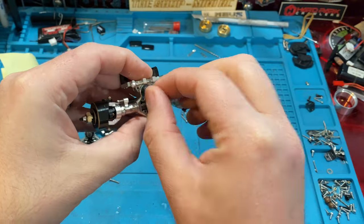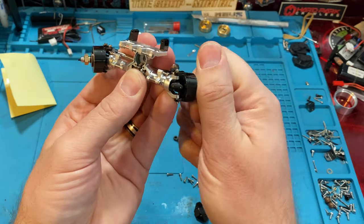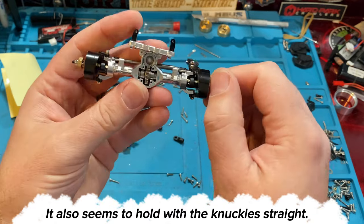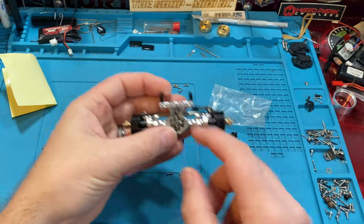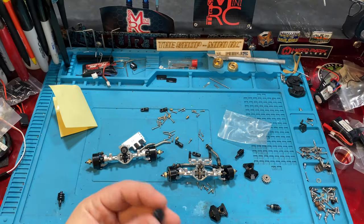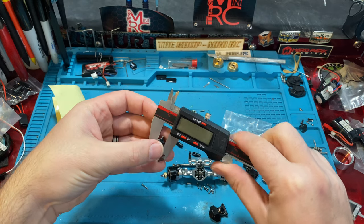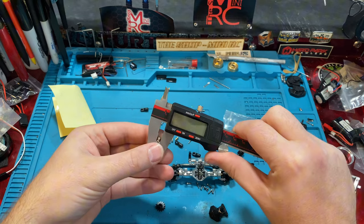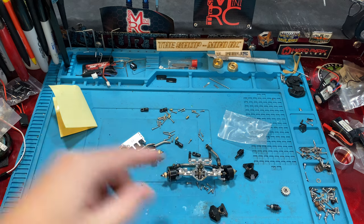So you can see how we did it. I can hold the gear and give it some nice pressure and it seems like it's holding fine, but who knows — could break out. Ideally they would provide a custom one with the extra width and extra flanges. You can see here the width of the front spur is seven and a half millimeters, whereas the stock is four and a half. So three total millimeters of difference, which is why we get one and a half on each side.